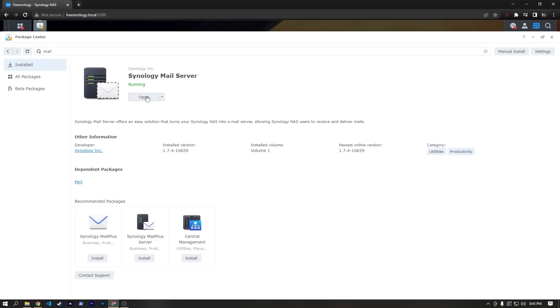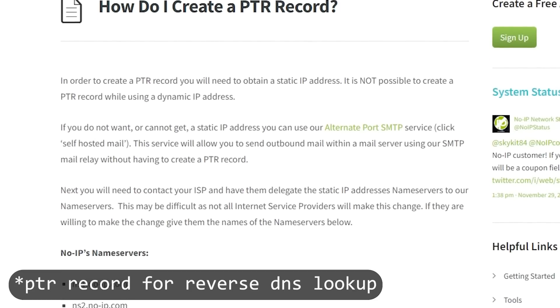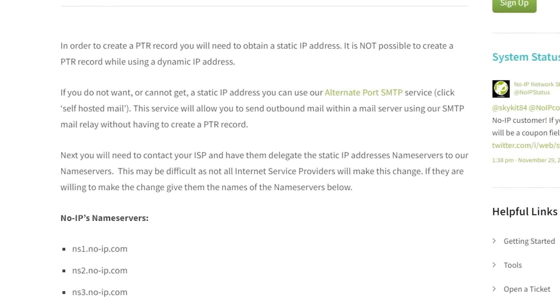You might be wondering how someone might actually access your website if it's running on your NAS. I'll talk about Dynamic DNS in just a bit, but if you have a registered domain name, there are plenty of guides to help you set up DNS records and port forwarding to your Synology. If you have a business and a website, you might also want to host your own mail server, which with DSM is completely doable. This was my first time ever setting up an email server, so there were a few bumps in the road. I was able to receive emails, but ran into an issue of needing a reverse DNS to send emails, which, because I don't have a static IP, wasn't really possible. That's not a Synology issue though, and setting up a mail server is something you'll really only want to do if you're running a business, in which case the reverse DNS stuff shouldn't be a problem.